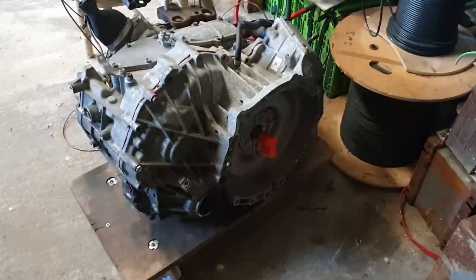So what we're going to do now is have a little bit of a revisit on our tuning, and we will again show you the tuning procedure. I'm going to use the Gen 3 system that I have on the bench here because it has got oil in it, so we can run this forward and backwards at higher speeds and make sure that we have our tune spot on. But I would like to be very clear that this procedure will apply to any permanent magnet motor, regardless of the kind of names that they like to call them. Sometimes it applies equally to this simple cheap Gen 2 Prius MG2 as it does to a modern Tesla Model 3 rear drive unit.